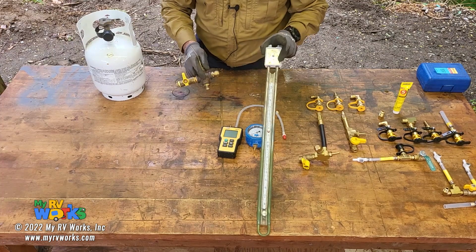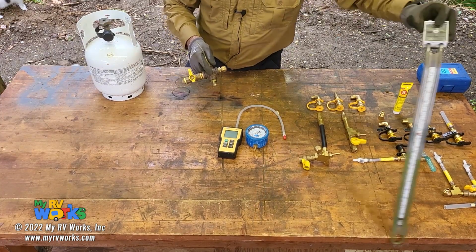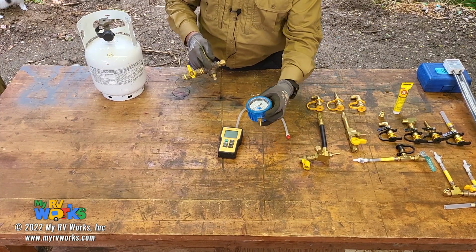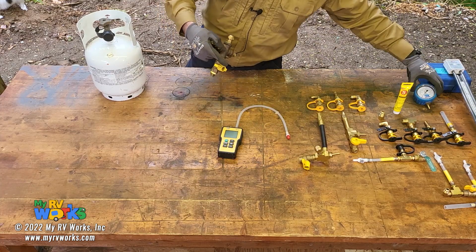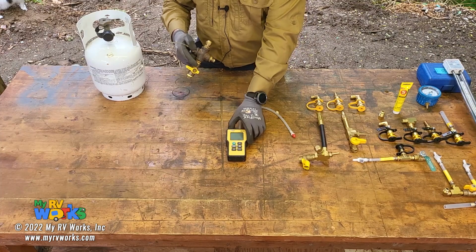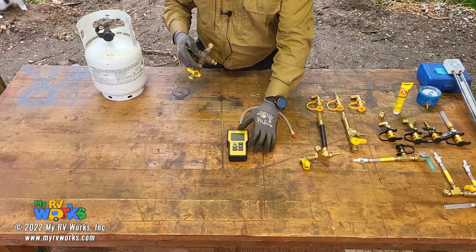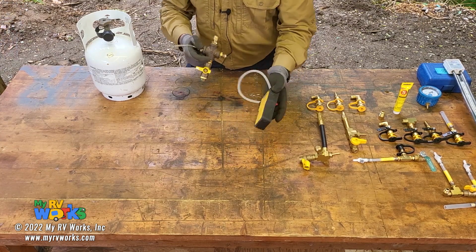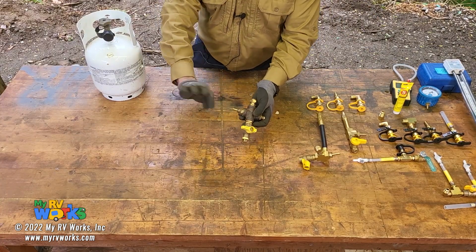These freeze in the wintertime, so you have the slack tube, which is extremely accurate, and I like it the best. The gauge, I have them. They're not great because you're only ever going to use the lower end of it over here, you know. And then the digital one is what I use the most because I can do minimum, maximum, averages, and I could look at different scales. So you would need a manometer. If you're watching this, I'm assuming you already have one. But your manometer would be connected right here.